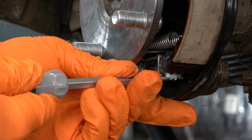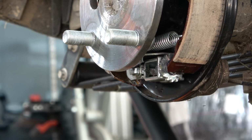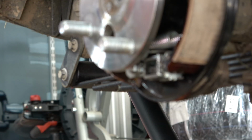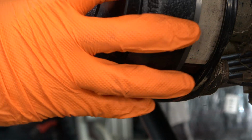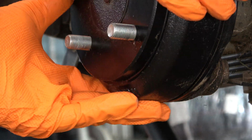You'll also notice that I'm adjusting the wheel and it seems as though the adjustment arm is stuck in the up position. I do actually fix that off camera. That's why you don't see a second screwdriver involved in this process. But after multiple attempts, I finally get the fit for the drum that I'm looking for. It fits snugly, but it still is able to be turned.